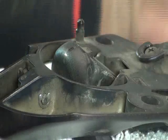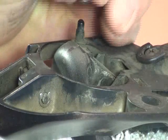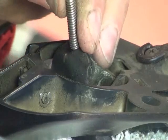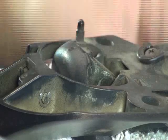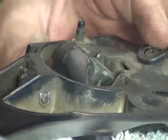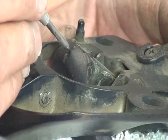The other way to do it would be to use a 6 millimeter bolt. That's a 6 millimeter shank, a common bolt. You take one of the bolts off the car and use it. And then that's actually also 6 millimeters. And once we know 6 millimeters, this is on a radius. So we're going to use a pin punch at our 6 millimeter mark.